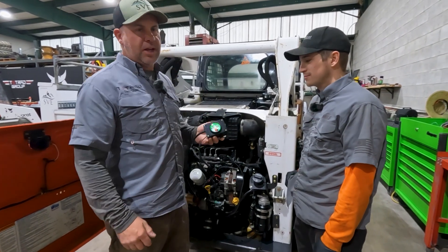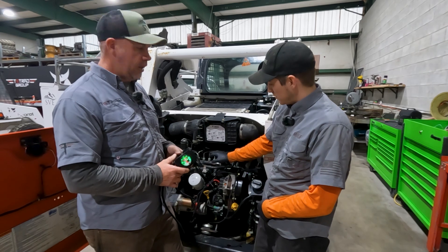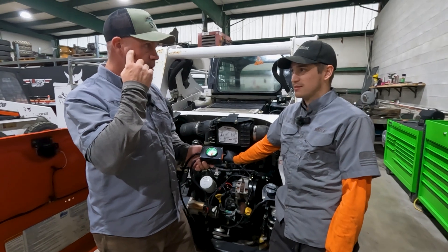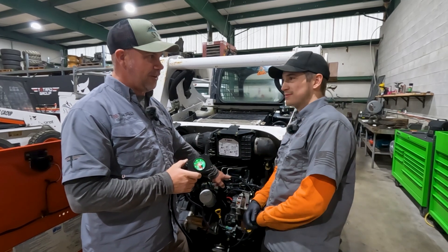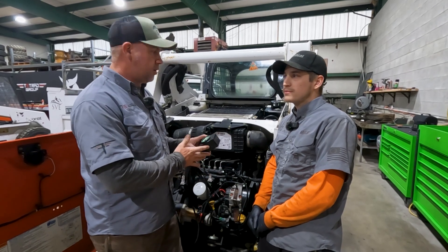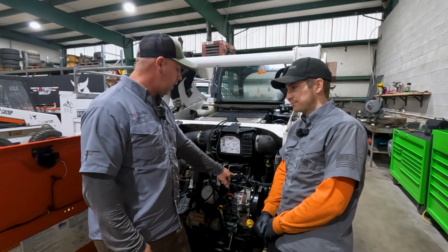That's a demonstration of our tool — it's awesome for diagnosing the fuel system and checking rail pressure without a laptop. There's also a mechanical gauge option. The advantage of this electronic method is no laptop needed. The disadvantage is we don't always know that our rail pressure sensor is working or accurate. We had a batch of brand new rails coming from the factory with bad sensors, and someone recently replaced the entire fuel system and still couldn't get it started because the rail pressure sensor was bad — the ECU was not seeing rail pressure.